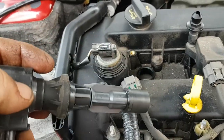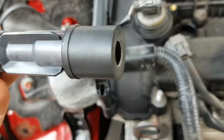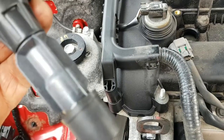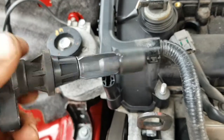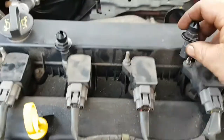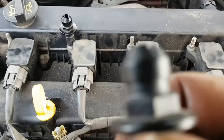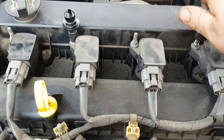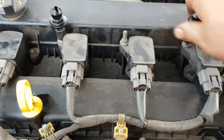So that's the new spark plug in. I'm doing one at a time just to make it easier, so I don't mess up the cables. When you've got these off, make sure none of your rubber is split and there's no oil on them, as that will cause damage. If you get any white streaks across the rubber, that means you're sparking out — something is wrong. This one looks alright. These just screw on; make sure you put them back in the right place, they are 15mm bolts on the head. These hold your top cover on. So spark plugs are all done.